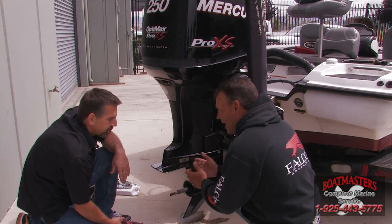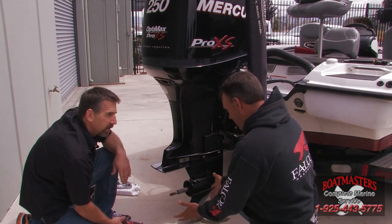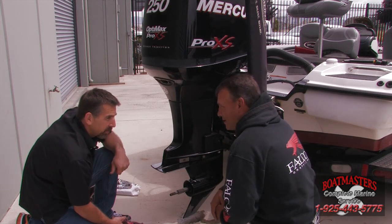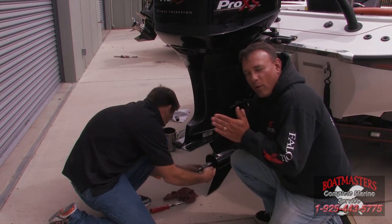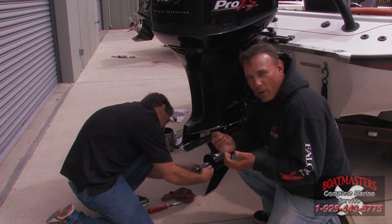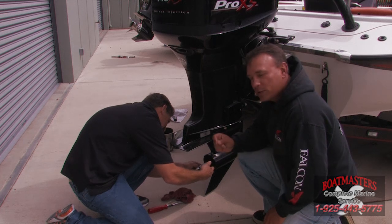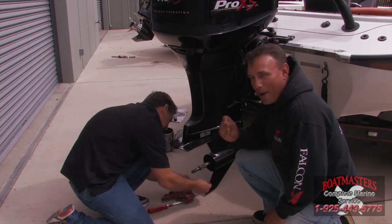Right. So I don't need to re-add any oil at that point, refill it. That's an okay test to do. Yep. And in my case, I just saved myself a nightmare on the water. Now, what we did is we just showed you my boat that pretty much had water in it, milky oil, and I've asked Mike to pop a plug out of another boat just to show us what the oil should look like without water in it.